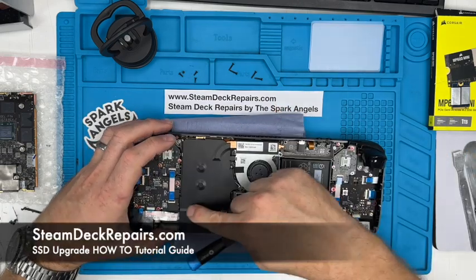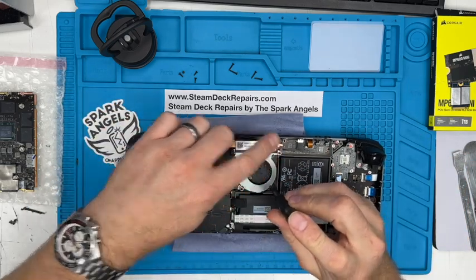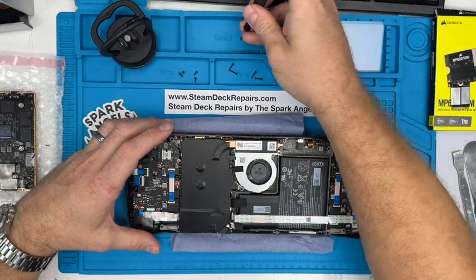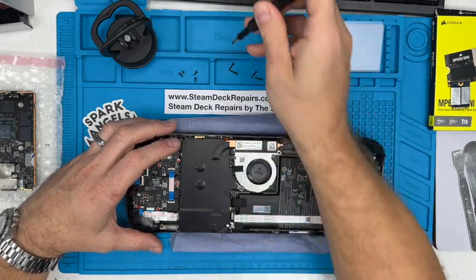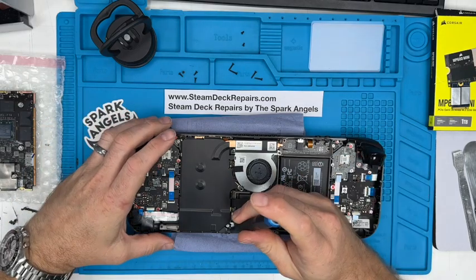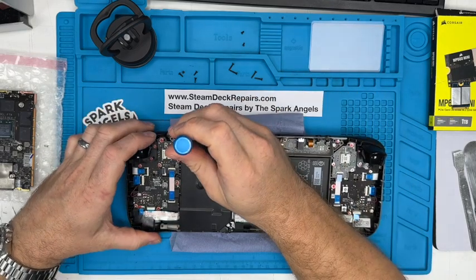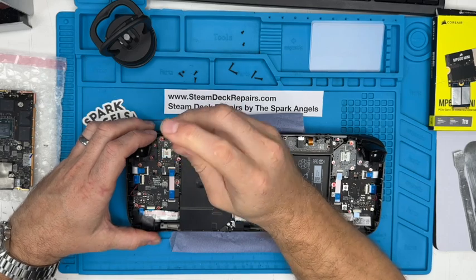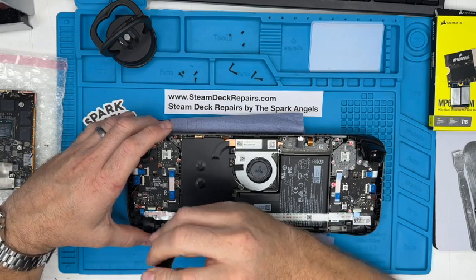Let's dive in. The SSD is under here, so we're going to take this out anyway. There are two screws at the bottom of the fan — remember those two screws were on the shell. Let's remove those and keep them separate. It's the first time I've actually done the Gen 2. Those two screws are the same size by the look of it, which is good. I think a lot of the screws internally are, which helps all of us out. And then there are two screws either side that we'll take out as well — pretty standard from the first one, same length screw, which is nice.